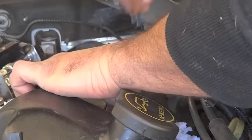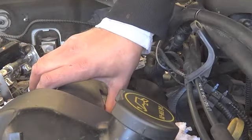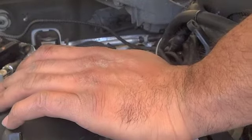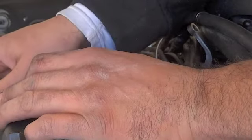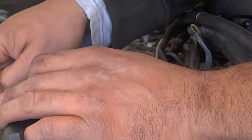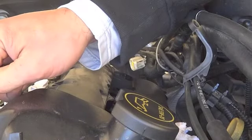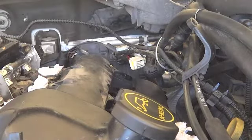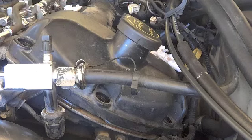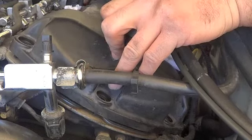So it feels like the valve cover is on there still pretty good. Just been sealed for years and years. I'm wondering what's the best way to break the RTV that they have sealed, because you can see right there, that's the RTV that you're supposed to put when you put the new gasket, and that's the black stuff, not the red stuff. So I'm gonna pause the video and see if I can break it loose. Yeah, that RTV sealant right there, it sticks pretty good, and it's a 12-year-old car, so I put a little elbow grease in it. It popped off.